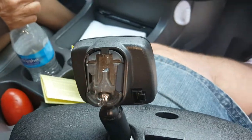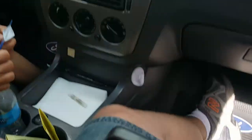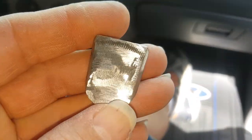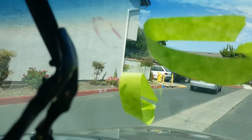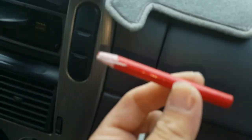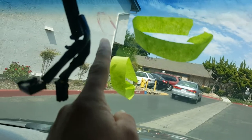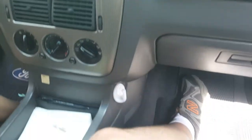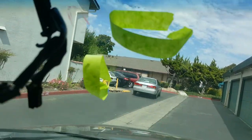What we've done is we've already cleaned the old glue off. We took some sandpaper — I actually used a grinder and ground it down because the rougher it is the better for glue. This is the windshield up here and we've already cleaned that off and marked it. You mark it on the outside of the window with a grease pencil or crayon. We've cleaned and prepped this thoroughly using Windex to get all the grease off. Everything is sanded, clean, and ready to go. This tape is just there to help hold it in place.